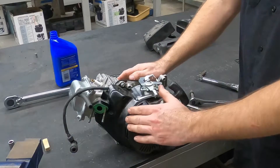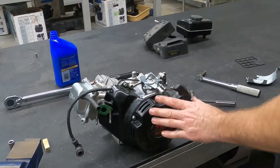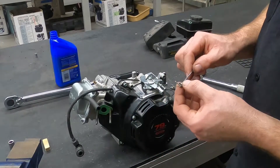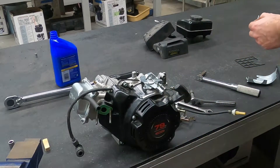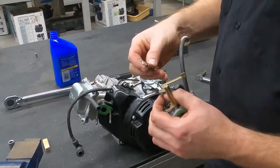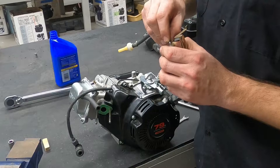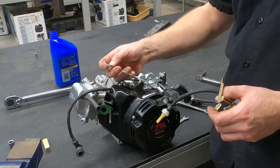So now, as we change the throttle control position, it changes the tension on the governor arm. From there, this long spring, which is sprung — and which is going to possibly screw up our governor stuff — kind of slides over top of that arm. I think this straighter arm will go into the carburetor, which means that the hooked arm needs to go into here.